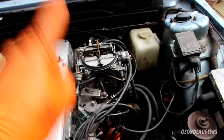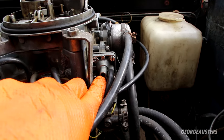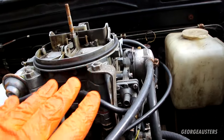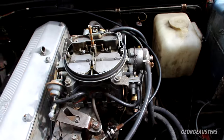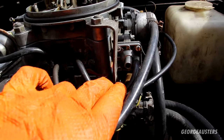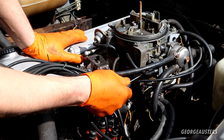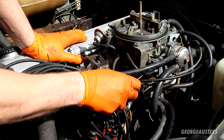Before getting all this back on the engine, I want to adjust the choke. There's a screw here — I have no idea what I set it to when I rebuilt the carb, but going off the second carb I received, it was 8.5 turns out, so I'm basically going to mimic that. The car tends to run rich and the choke never seems to open fully, so hopefully adjusting this will help. I checked and the adjustment screw was only one and a half turns out — so I'm going to do a full 8.5 turns out.